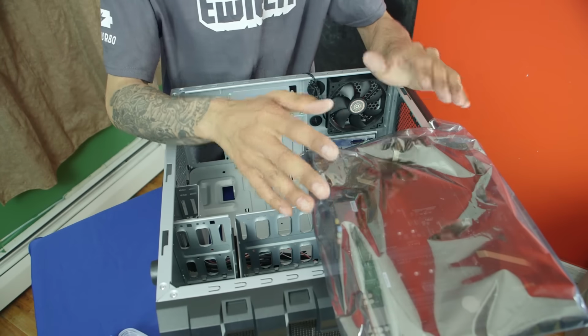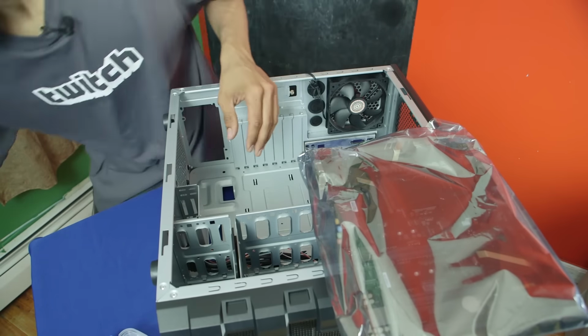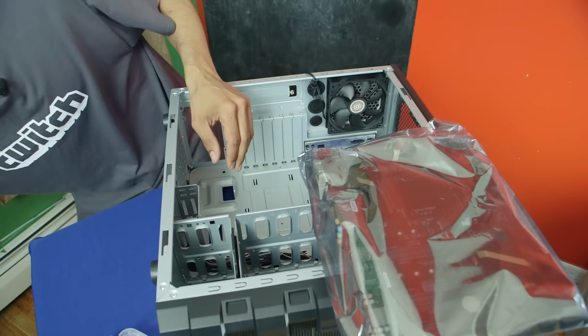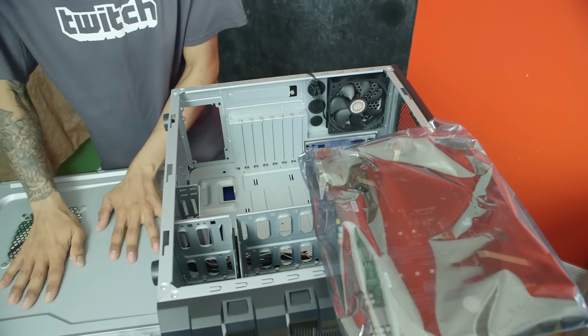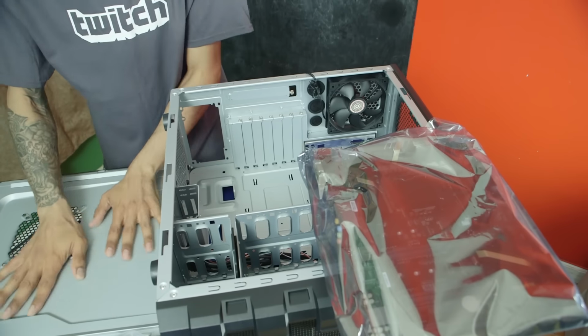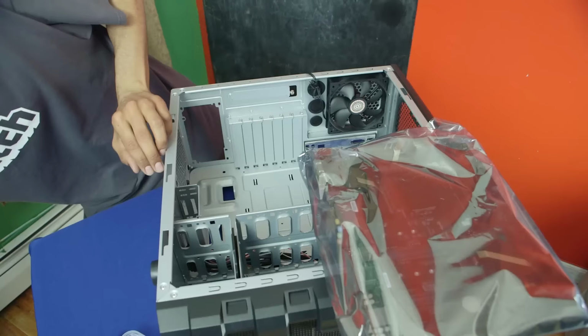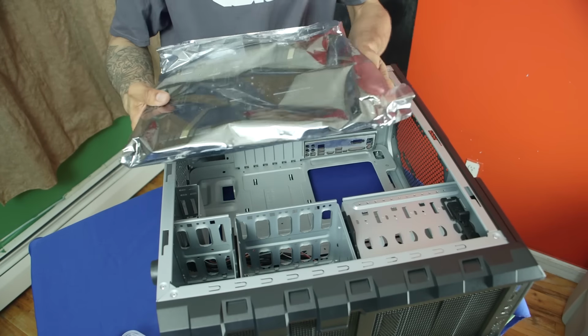This is our motherboard. I'm gonna keep it inside our static bag. I don't have an ESD band, which is really bad. So what I'm gonna do is get one of the side panels, just rub, get all that electricity out of you. And then on the next video, most likely I'm going to have my ESD band. And what we're gonna do is we're gonna take this guy out.